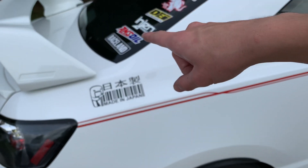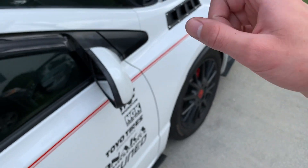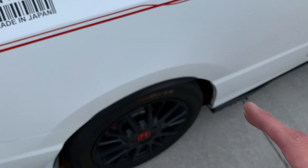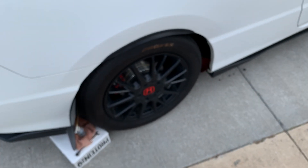You'll do that for each corner, starting with the rear right, then you'll go to the driver side which is the rear left, then the front right, and then the front left. You'll just continue to do that until you feel like you've gotten as much air as you can out of the system, or once the pedal is feeling good again.